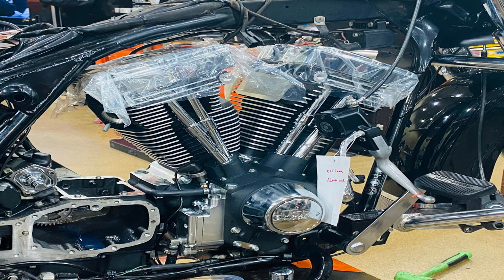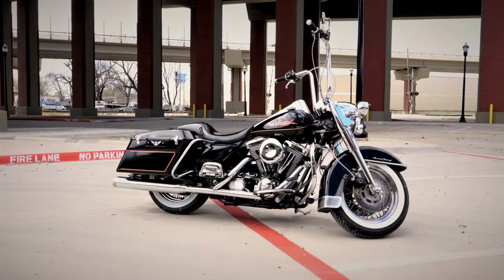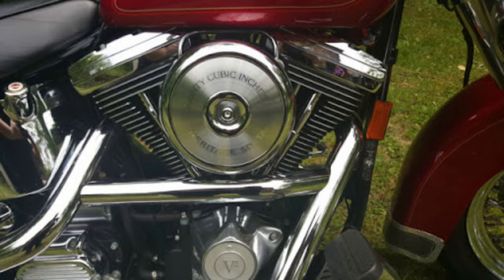The most reliable S&S engine they offer is the S&S V80 variety. This is an excellent choice for a mild, basically stock replacement, but you're going to get a pretty good bump on that V80 engine from S&S due to the Super E carb, S&S 508 cam, and the S&S high-flow cylinder heads. It comes with a two-year warranty and it'll run you about $5,600 at retail, but you could probably get that a little cheaper depending on where you buy it. With a good exhaust system, this brand new engine will really wake your bike up and should put you somewhere around 80 horsepower, which is a big gain over a stock Evo or even one that's cammed out a little bit. And with good tuning you might even get a little bit more than that, while still maintaining that longevity and reliability that the Evo's been known for.